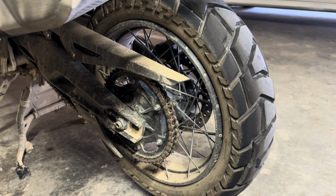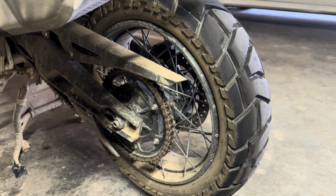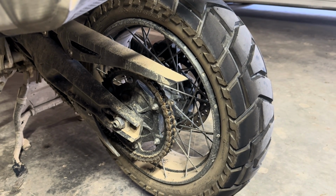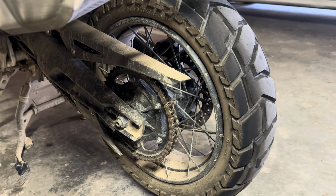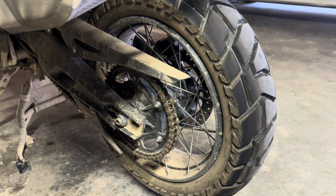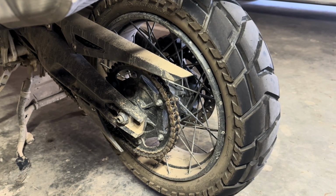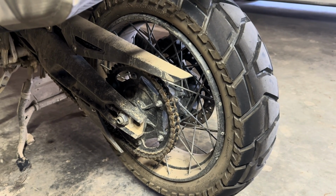I've always had to air down those other 50/50 tires a little bit because I find myself skipping and traction braking in corners when they're pumped up that high. So that gives you an idea of the kind of compound here, and the stiffness and the grip of this tire on the pavement.